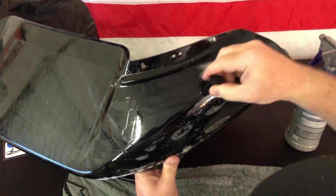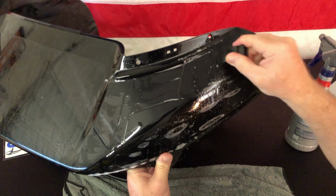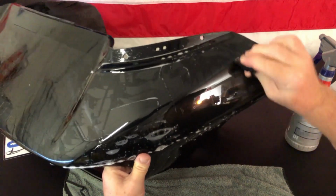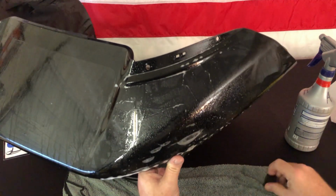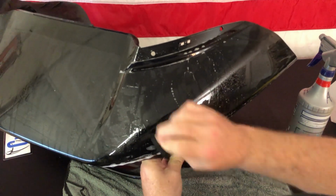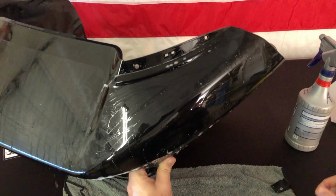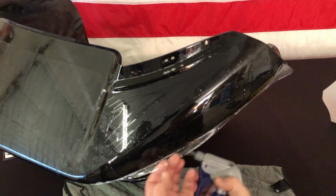And just moving all that soapy water out. So again, we got to come this way from this anchor zone and come down over that edge. Again, you want to make sure that top is wet with the soapy mixture so that this squeegee slides really nicely. So that looks great. And now for the final step, a little alcohol under this edge to lock that thing down.